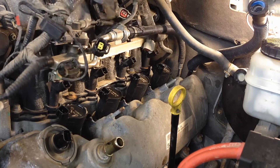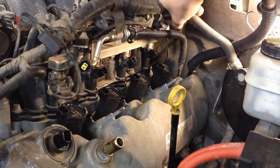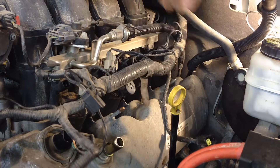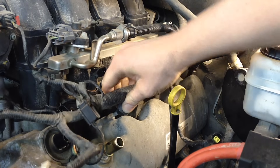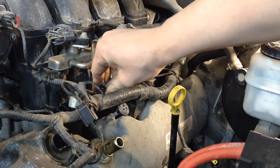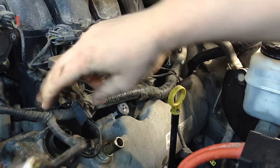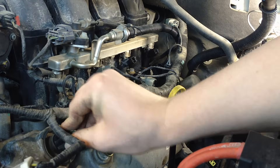The harness just comes back down — all I did was pull it off and tuck it up out of the way. I never touched the fuel lines or disconnected anything. The push clips go into the valve cover to locate the harness in place. Everything has memory to it so it just pushes right back where it belongs. Then reconnect the VCT solenoid connector.